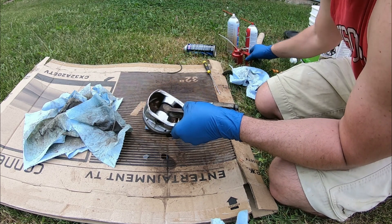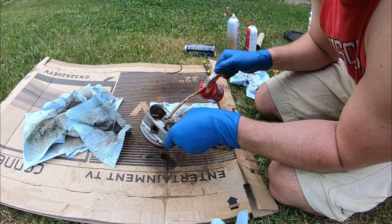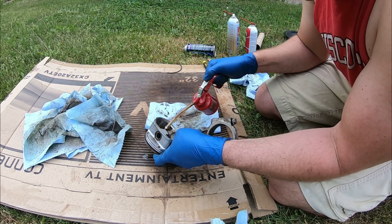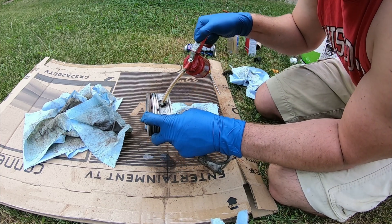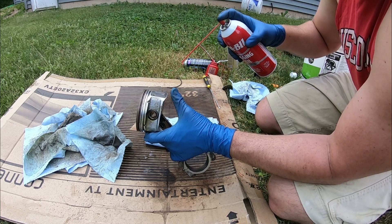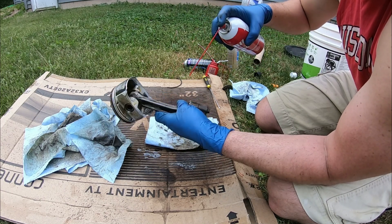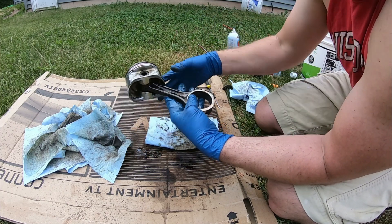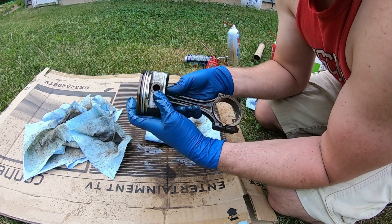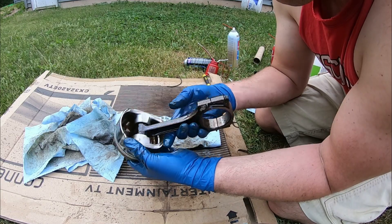Now when I'm done, I want to lube everything up so these don't go dry, since we've just been spraying a ton of carb cleaner and brake cleaner in there. I was also just taking some fogging oil and spraying the whole piston down so we don't get massive rust, and just kind of working the rod so everything is nice and coated. I already did three so I got four more to go.